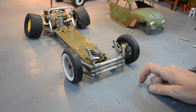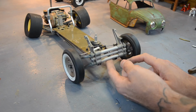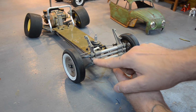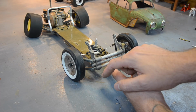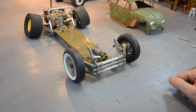The main thing that I needed to do to make the arms travel up is it has these stops made on it. As you can see at the up position here, that little stop catches. And there was one that came off of the top arm and allowed it to only go to about there. So we got almost half an inch more drop out of grinding that off. That's all I was hesitant to do, was to hack up the original piece, but that was the only way to go about it. So here we are.